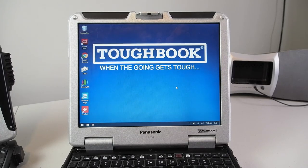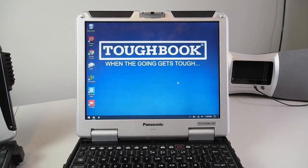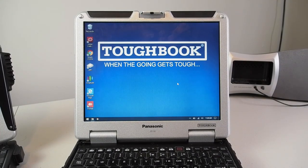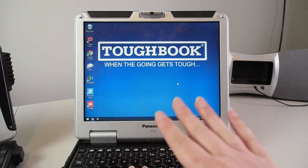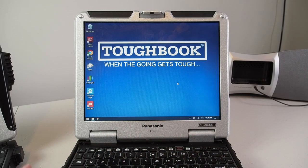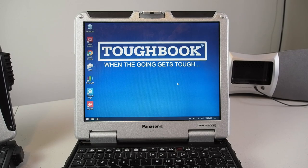About the thermals, there's a few things I've thought about doing to improve the thermal performance. I thought about using a copper shim in place of the thermal pad and a couple of graphite thermal pads, which are designed for more high-end CPU cooling applications, like one on either side of that. The only thing I can see getting in the way of that is, since the CPU cooler is mounted to the chassis and then the motherboard goes on top of it, it's going to be difficult to line that up with the CPU and not have it fall over while I'm trying to mount everything. So, if you guys have any thoughts on what I can do about that to improve it a little bit, please do let me know.